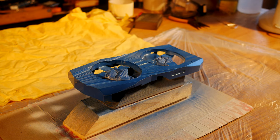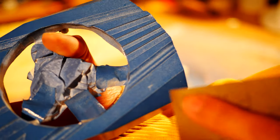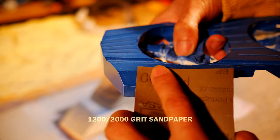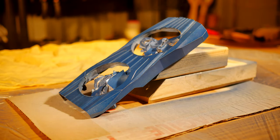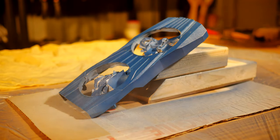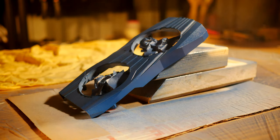Dust in the air is an inevitable reality of DIY spray painting. Once dried, do take care of these bits by sanding them down with a 1200 or 2000 grit — so very fine. And also acknowledge that spray painting in itself is quite a risky thing. Expecting perfection on your first, third, fifth go is unreasonable.